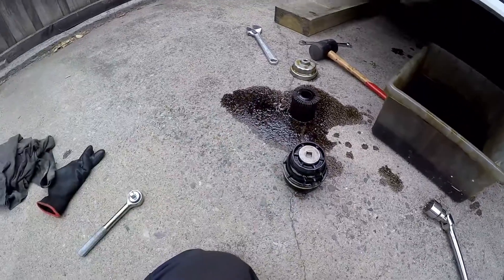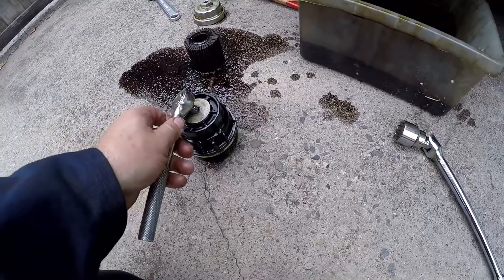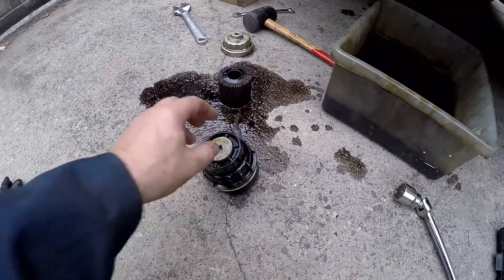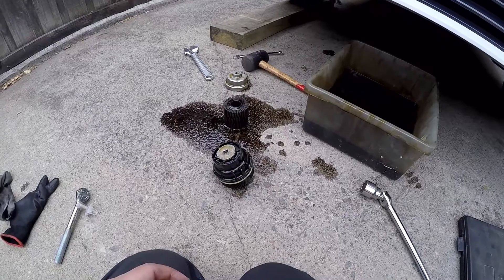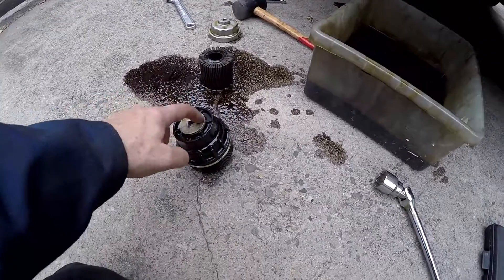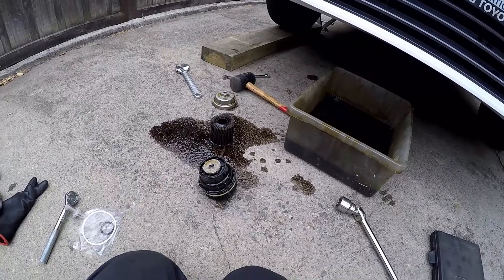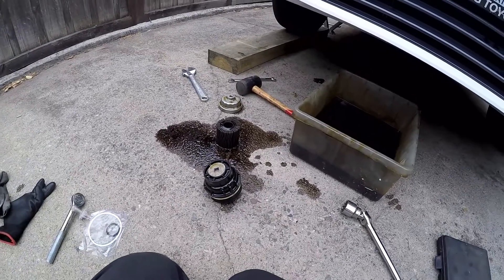Now what you're going to ask, if you've never done it before, is: what's the other o-ring for and what's the little plastic plug for? What you do is get a handle from a socket set and undo this metal bolt — call it a screw, bolt, or plug — take that out, and it drains the oil out of the filter canister, then you unscrew it and take it off. It's a total waste of time for anyone who's used the old canister filters. The second o-ring is because you take the o-ring off that metal plug and put the new one on and screw it back for next time. A lot of time-wasting, but I suppose it's Japanese politeness — they don't want you to spill oil or get oil in your eyes, which is why I advise wearing protective goggles.